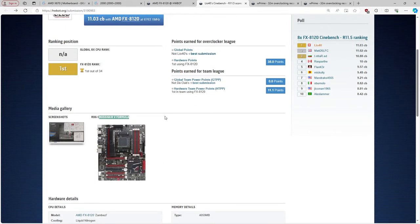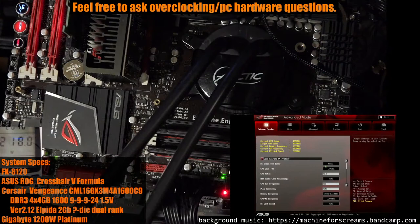And usually if the motherboard's voltage limit is too low, it's because the VRM will up and die if you set the voltage higher. But other than that, great platform for LN2 overclocking. By far the easiest to run, assuming that the motherboard is up to the task. Which mostly just means not blowing up.